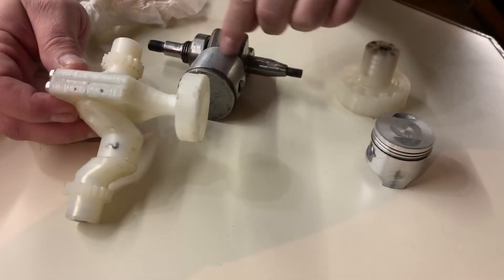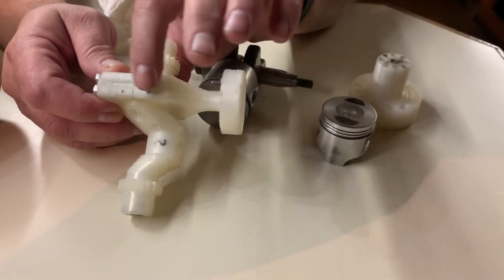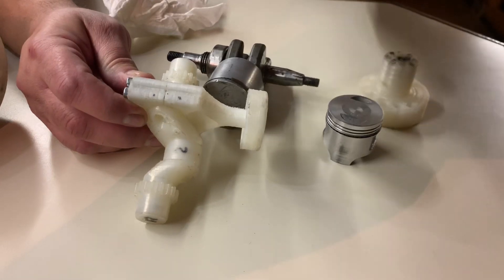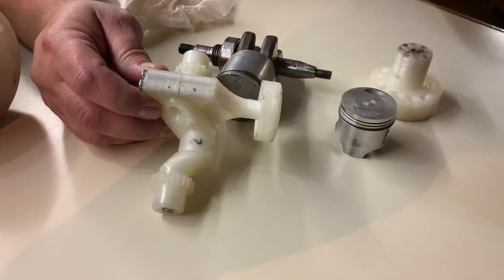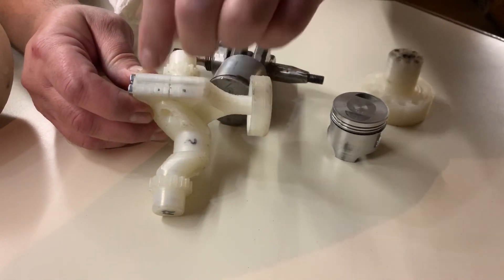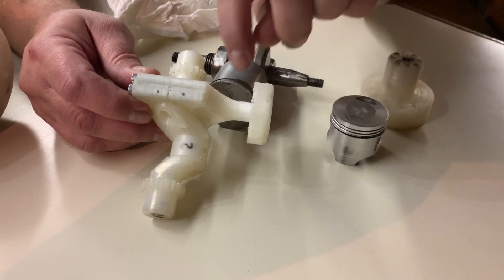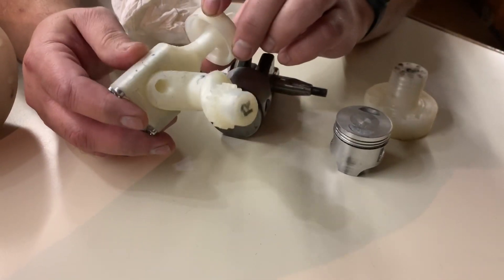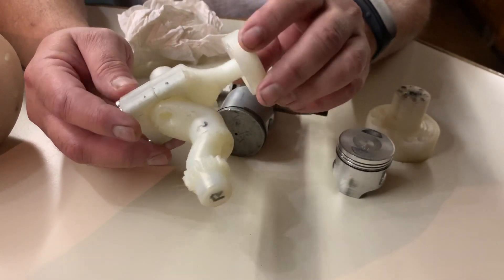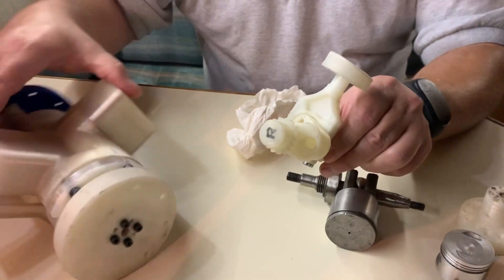This is what the piston looks like. As I said, there's no wrist pin and there's not really any conventional skirt like you would have in a conventional piston. There is an elongated section down here that is lubricated — it's pressure-fed oil from the block. That pressure-fed oil lubricates this elongated journal here, also feeds the crank pin lubrication, and can feed pressure-fed oil up to squirt the underside of the piston as necessary.